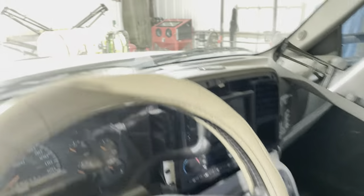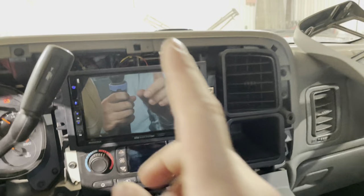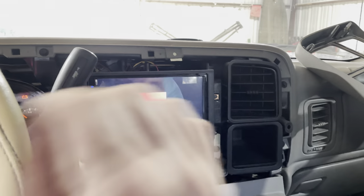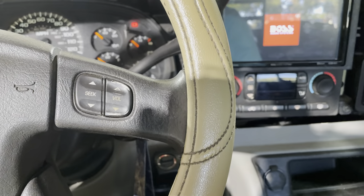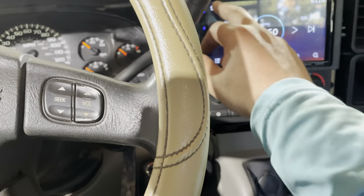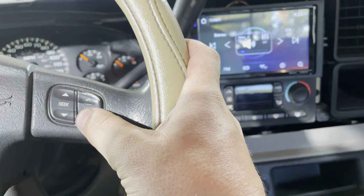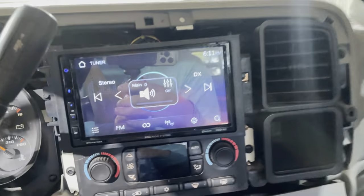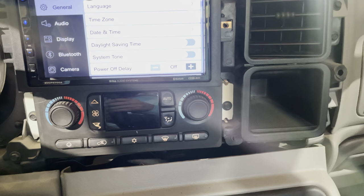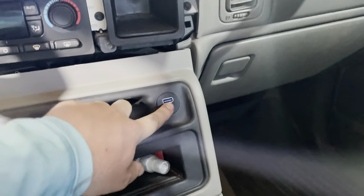All you do is turn on your ignition. On the back side of the programmer there is a little program button. You tap that button, wait for it to turn green, and then hit your volume — everything should be good after that. If you have any problems, Crutchfield has very good customer service and they were very helpful. I also made sure Apple CarPlay worked — I got that hooked up to the USB port, and the USB-C down here is just for charging.